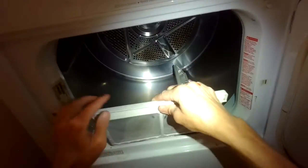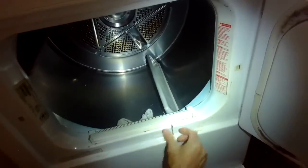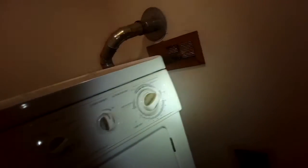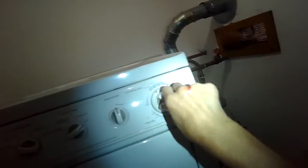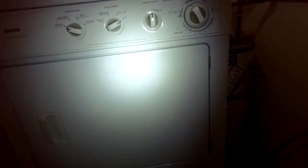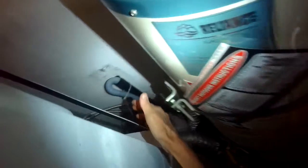It ended up working really well — it heated back up within about a minute and was at full heat. That's all it needed was that new igniter, but the gas coils are a good thing to add while you're in there because they go out about every four to five years. We set the dial, turned it on, went back, and I could feel the heat coming out the back. I also added the vent tube back on.